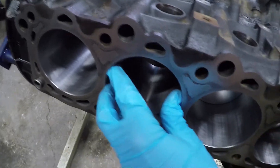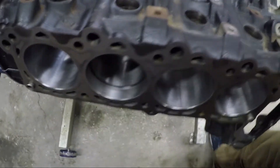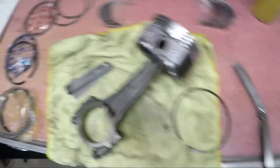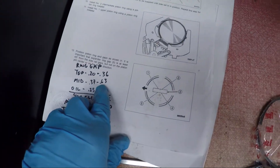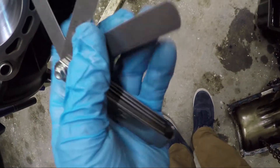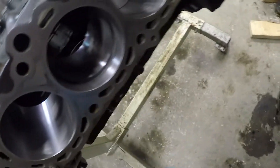You gotta be careful with these — I probably shouldn't be doing it with one hand because they're fairly fragile. It's easy to snap one, and it sucks if you do snap one because this piston set only came with the exact amount needed. I've got that in there. Our middle ring tolerance is 0.37 to 0.63 — hopefully this does not fit, and it does not. I am under my max, so now I'm going down to 0.38, and if that fits we're good — and it does.